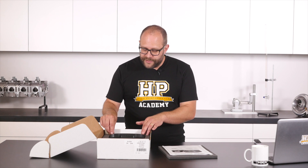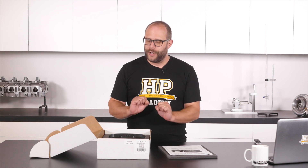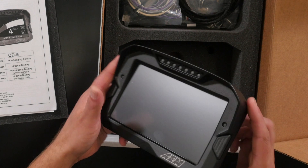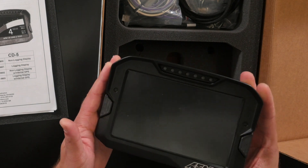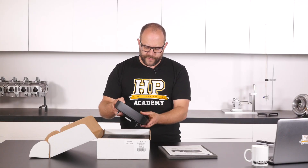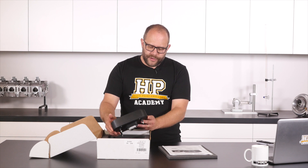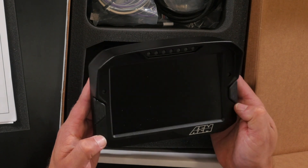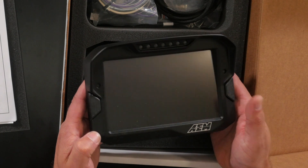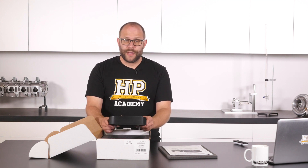Cards on the table, we have actually had this box open before as we needed to take some promotional shots, but the dash was originally supplied with a protective film over the screen. The dash has a satisfyingly chunky construction — it's got a little bit of heft to it, but not really unreasonably so. It looks like a die cast metal case with a black textured powder coated finish. It is rated to IP65 sealing, so while it's not submersible, it is fine to install in a boat or UTV where it might get splashed or a little bit muddy. The buttons on the side are textured rubber and they're pleasingly tactile, so you should be able to reliably press them even if you've got racing gloves on.